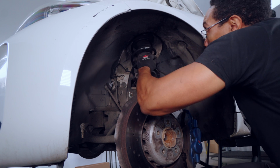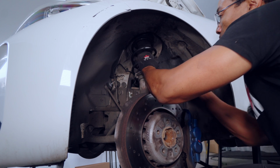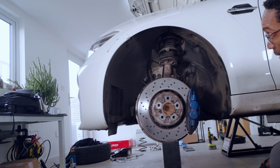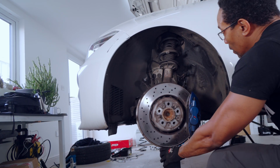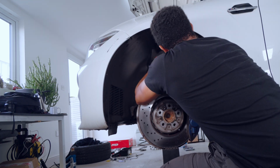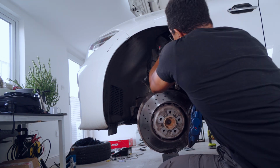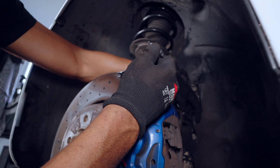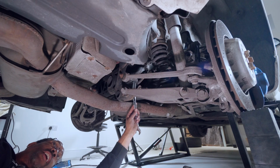Wheel assembly? Is that what it's called? The brake disc. And I'm just going to raise the jack so that I can get the shock aligned with the top mount, and that's basically it. Once you've got it all aligned up, you can just screw the top mount to the shock and reattach the ABS speed sensor wiring and the brake pad wear sensor wiring.